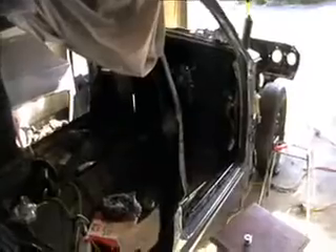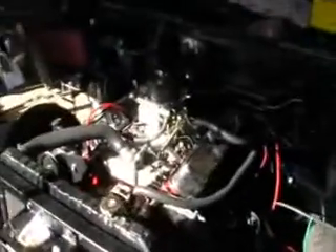I've been fighting a lot of electrical demons recently on this thing. The lights are shocking — I won't bother showing it — but I've had to redo a lot of the wiring through here, rewire the alarm, triple check all the loom, just because some of it's been a bit shoddy over the years. And rewire the dash part of the loom properly, because this has got a GDS dash in it, and the wiring between that and the normal dash is actually slightly different.